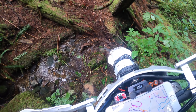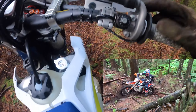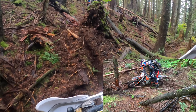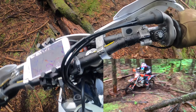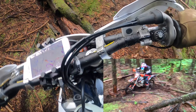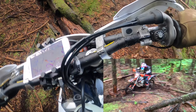Those are really the two issues I have with the bike: the low idle and the leaky power valve. The fact that it doesn't come with a spark arrestor stock is a big miss on KTM's part. But I've got this thing running right where I like it and I'm really, really pleased with the bike. At 15 hours I think it's pretty well broken in. Forks are broken in, suspension feels great. Whatever they've done to the mid-valve on these 2021 AER forks is phenomenal — this thing really just soaks up the bumps, very confidence-inspiring.